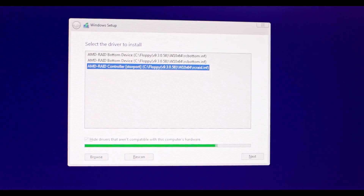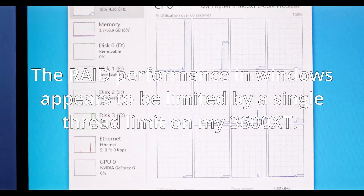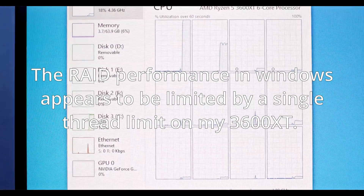I got Windows installed using AMD's fake Windows RAID. It works fine and had pretty good benchmarks, though it's a bit slower than my Linux software RAID at only about 6.7 gigabytes per second. But it really wasn't bad. The problem is it's comparable to a standard Gen 4 SSD these days, so I don't really see the point of using it.